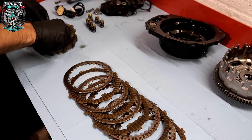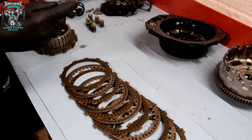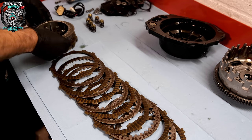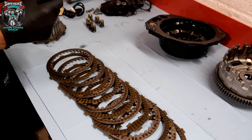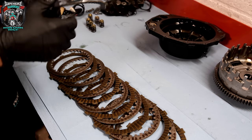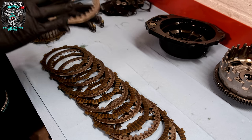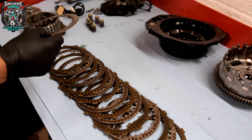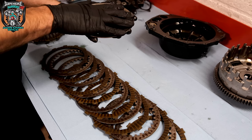The rust isn't necessarily a deal breaker. You could just put it in the soda blast cabinet or use some glass bead on it and see how they clean up. Ideally though, you'd want to just put a new clutch in — it's obviously been in there a long time. There's a service limit for the width of the clutch plate, so you can go around with a vernier or a micrometer and measure them. The important thing about these steel plates is they've got to be completely flat — lay them on a piece of glass or a surface table and check with a feeler gauge.